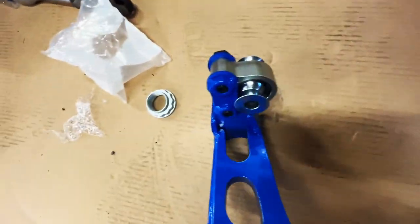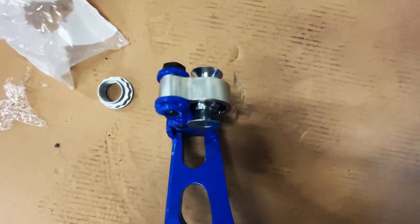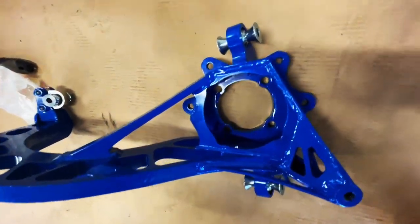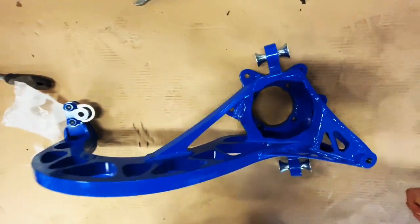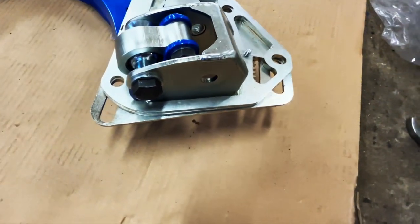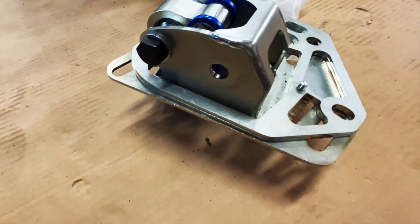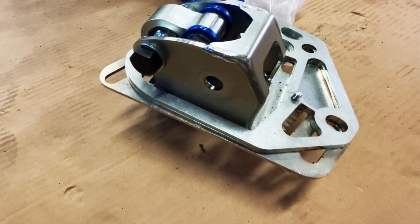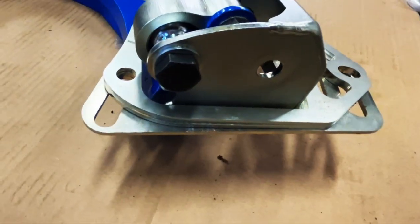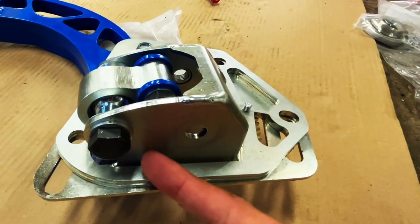As you can see, there are a couple of differences from the original setup. There's a spherical over here that has two positions, and we run a bolt-in wheel bearing from an E65 or E63 BMW 7 or 6 Series. You can see there are two positions for the anti-squat setting — you basically flip around that silver part that has a spherical in it, and that changes your anti-squat curve. The plates below that have the easy quick adjuster for the toe of the rear of the car.